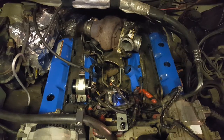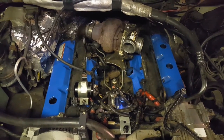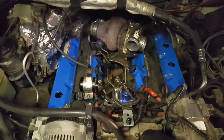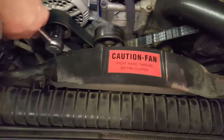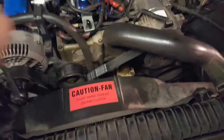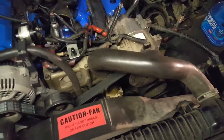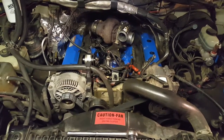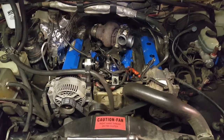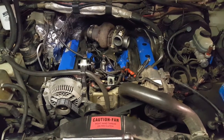You'll hydro-lock the motor and can mess some things up. Best thing to do: put your new injectors in first — if you don't, you're just pumping more oil and fuel into the cylinders. Put the new injectors in, then pull the glow plugs out of every single cylinder. I've got all eight glow plugs out. Probably best practice to turn it over by hand — some guys say that's not necessary, but you can do that right here on the alternator. Just put a socket on there; it doesn't matter if you spin it forward or backwards. All you're trying to do is move those pistons up and down and push the oil out of those cylinders. The oil will all come out if you crank it with the starter, but it's pushing it out through a pretty small hole, so it's best to crank it over a couple times by hand to clear everything out — then crank it with the starter to really blow those cylinders out.